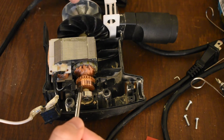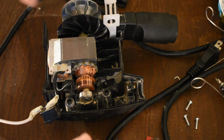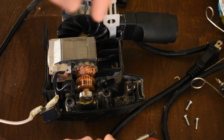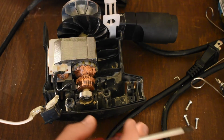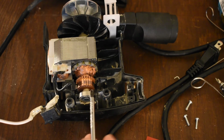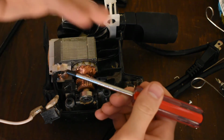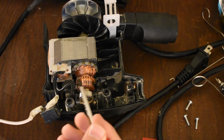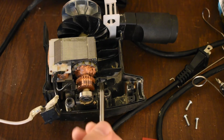There's some bars that are barely worn, and there's streaking, and it's not groove streaking. Sometimes the brushes come serrated, and that helps them wear in evenly and seat properly. This is not that. The spring is too weak to maintain good contact with the commutator bars. And potentially the commutator bar mechanism here, that piece is not completely round as a whole unit.